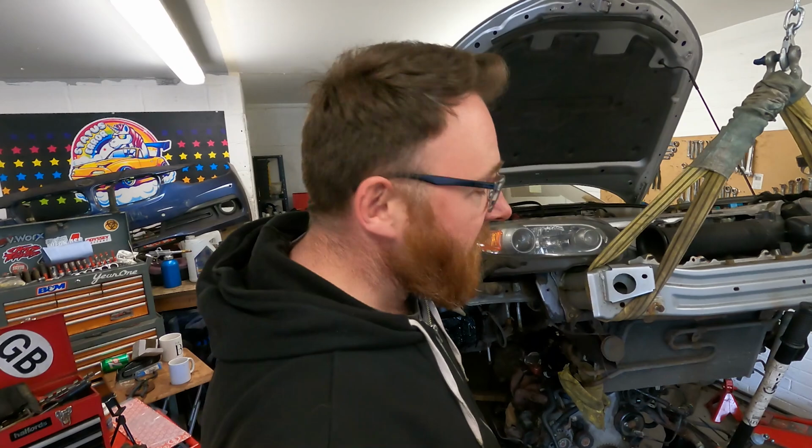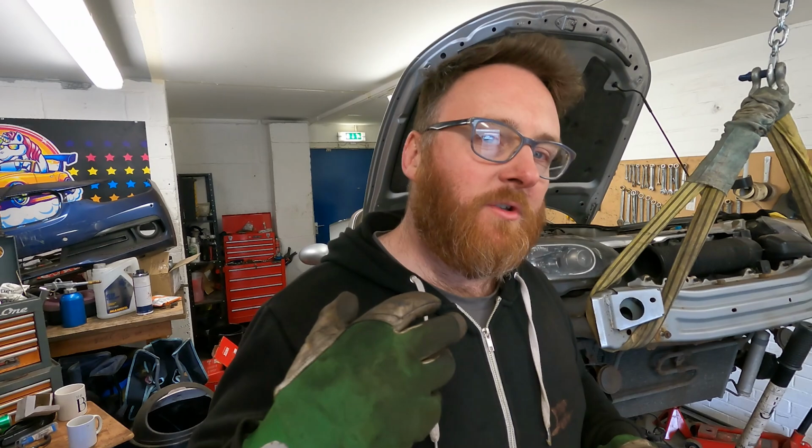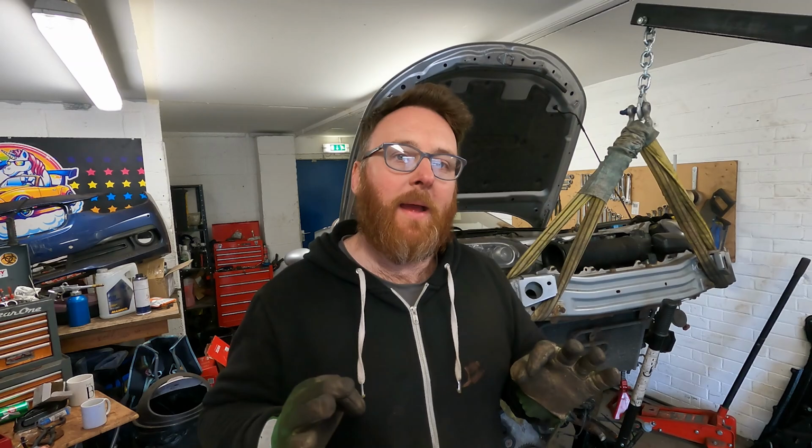We're going to start bringing this body down so that we can then bring axle stands back under it and secure the body and then bring the engine up to it. But there's still some things that can foul. Now, not the things that gave us issues on the way out, such as the steering shaft, that's out of the way, but things that we need to watch when orientating on the way back in.